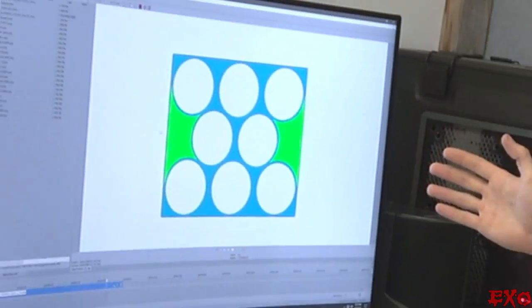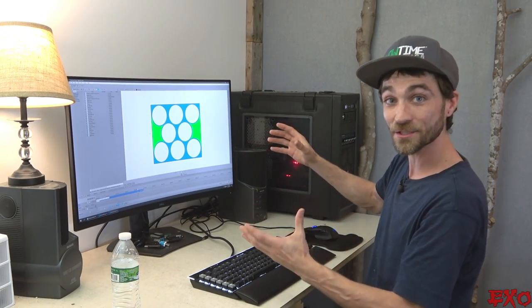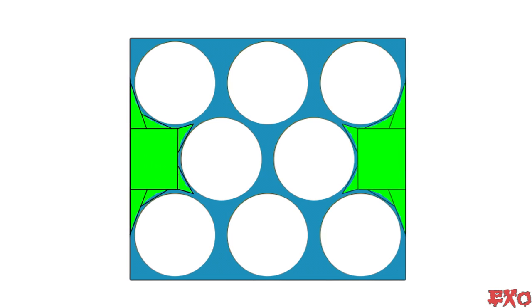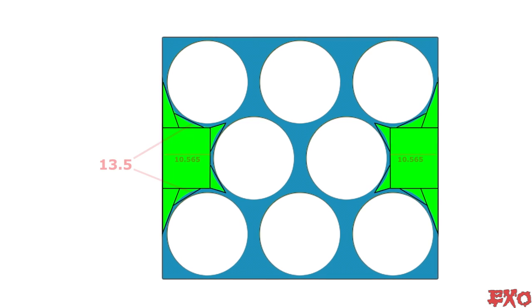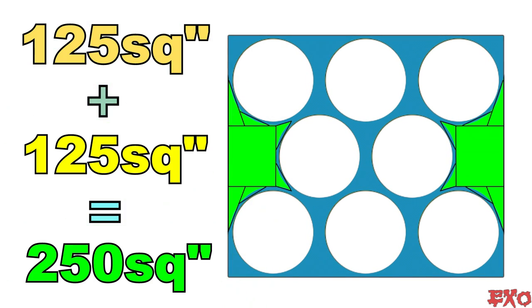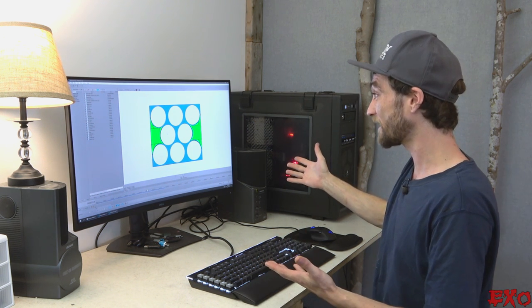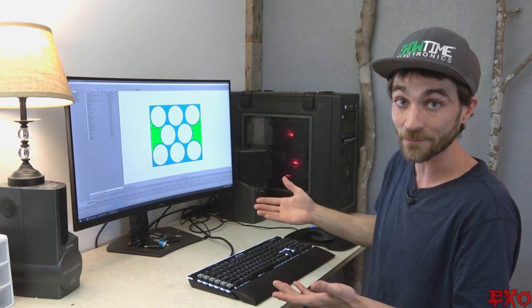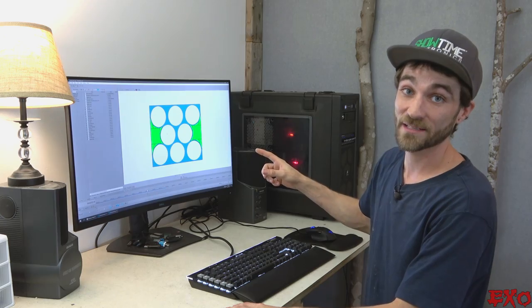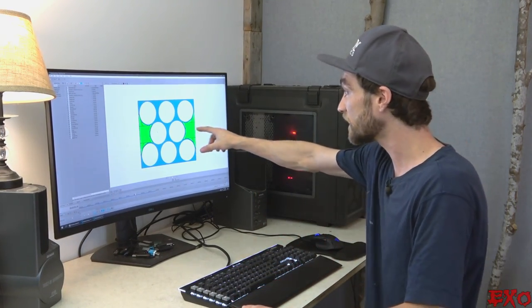To calculate the port area for this crazy looking shape though, I just break it all down into easier shapes. If you look closely, there's a bunch hiding in plain sight, a square here, a couple triangles there. I add those up for a ballpark idea, subtracting a pretty conservative number for the missing bits. So all in all, this port layout is roughly 250 square inches. Whew, a little smaller than I'd like for 48 cubes, even though a Series Tune Bandpass does tend to like smaller rear ports. This does have me on the fence now, especially because I'd probably stick a couple braces in there too.